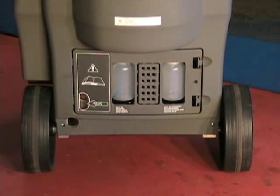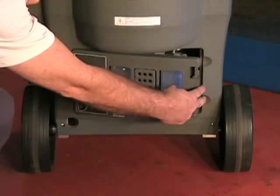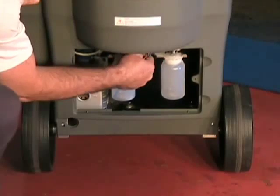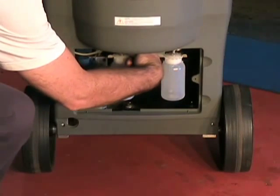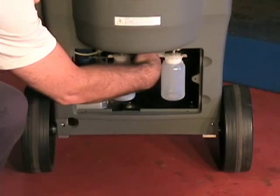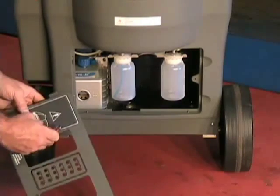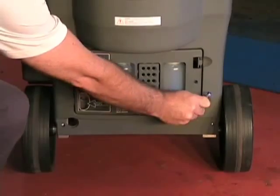To set up your new CCST388, start by backing out the scale travel pin. Remove the lower back cover and find the 10mm locking nut in the center, behind the oil discharge and new oil bottles. Use a 10mm wrench to unlock the nut and then back the 10mm bolt out about 7-8 full turns. Leave the pin in place to be reinserted in case the unit needs to be transported or rolled over very rough surfaces.